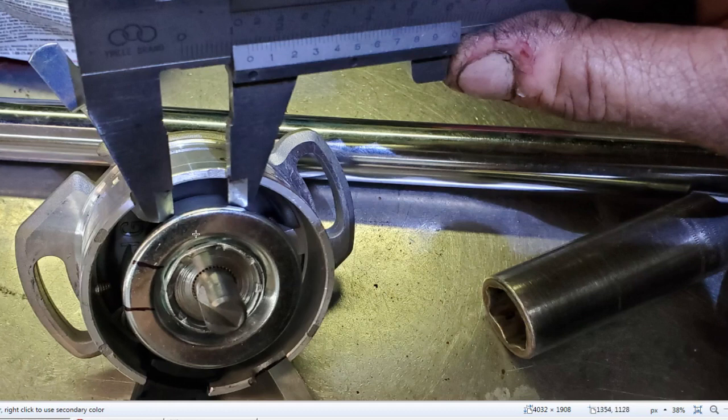And again, because it's a 5-cylinder, there's 5 of these. So there's one here, one here, one here, one here, one here, in total 5. 5 metal shutters and 5 open windows. So after installing this thing, I couldn't for the life of me adjust timing, and it was running incorrectly, almost like misfiring, setting that camshaft position sensor fault code. I pulled the distributor out, and that's when I did some closer looking.